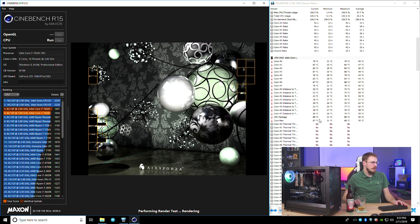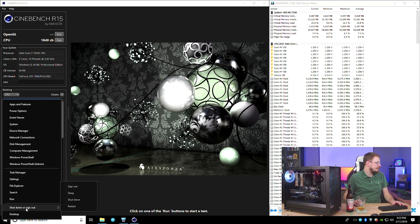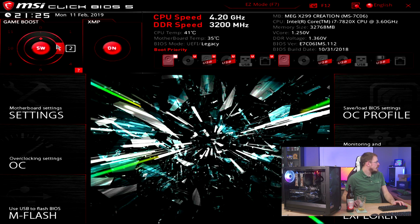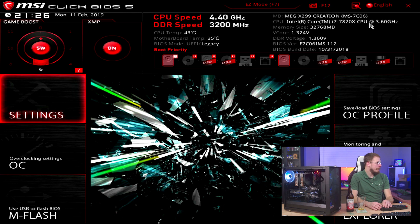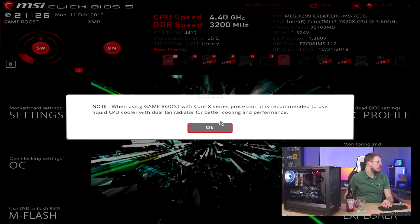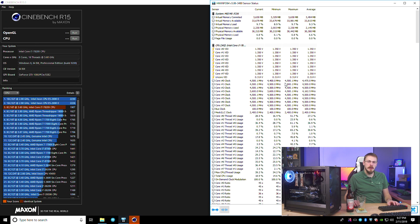Let's reboot and see if we can dial in a little bit faster overclock. The interesting thing is we're peaking at 4.2 gigahertz — according to my chart we should be at 4.5. The 4.3 gigahertz is actually the all-core turbo for stock speed, so I'm not sure what's going on here. Apparently the manual is not quite correct because that only cranked it to 4.2. So let's try 6 — that's 4.4. Let's see what 8 is. So we went from 2 to 8. We're at 4.5 now, and that's kind of what I wanted from the beginning. Now let's give this a final test.